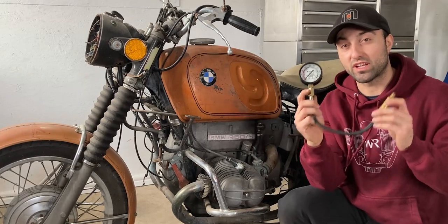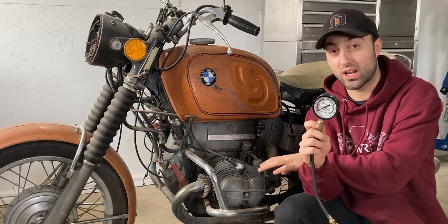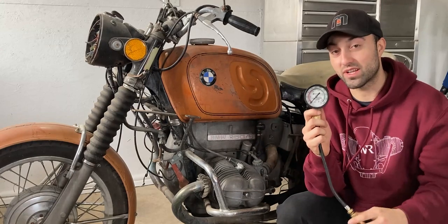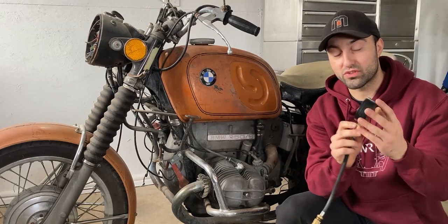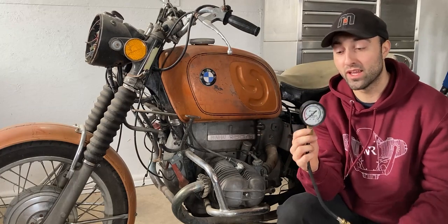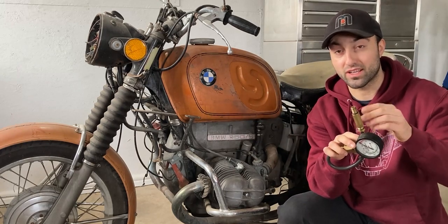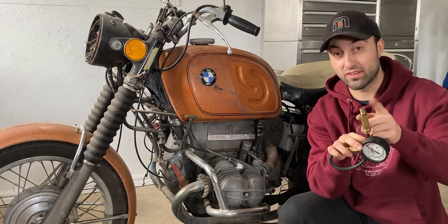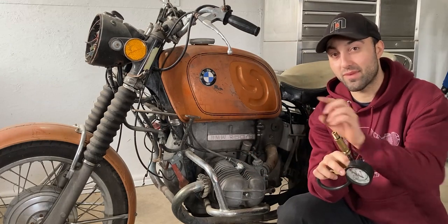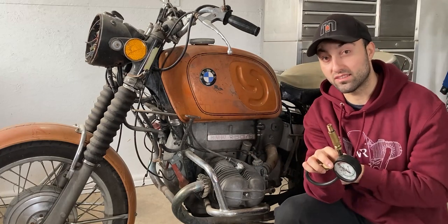I'm close to the BMW and I have my compression tester gauge in my hand. All this consists of is a gauge — in our case since we only have to have around 140 to 150 psi, this gauge actually only has to go up to 200 or something in that range. I have a gauge right here which reads up to 300 psi, so this is sufficient to read our BMW compression. Then we have a hose which leads to an adapter, and this adapter has a couple of combinations in case the spark plug is a different size. I believe this is the correct one for this cylinder head — the thread should be exactly the same as our spark plug. Once I take the spark plug out I will compare it with this thread and check if it is the same before I thread it into the cylinder head.